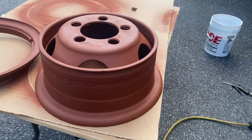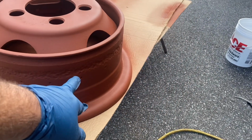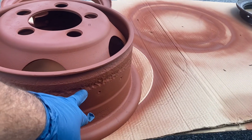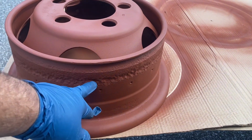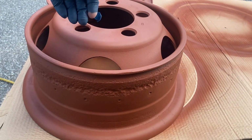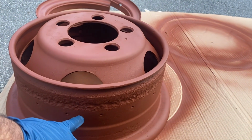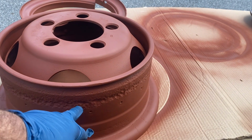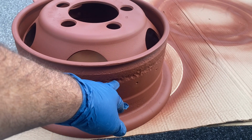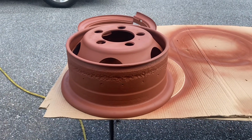I know there are some concerns here. There was a gentleman that posted a picture of where a rim had failed, and basically a whole section of this busted out and the inner tube came out in this direction. So I'm probably going to take a micrometer to this and just measure some thicknesses and see what's going on. I don't know. I guess we'll find out. Maybe that'll be the spare tire.